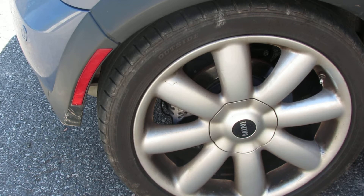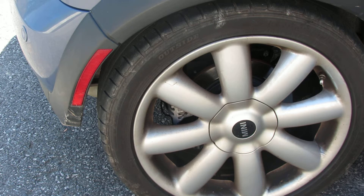We are here today installing the 507 flow-through tow car pack. We suggest utilizing the tow car pack because our flow-through sensors are slightly over 2 inches in length, and with that kind of length, it can cause the sensor to actually go beyond the sidewall of the tire. Hence, we have the tow car pack.